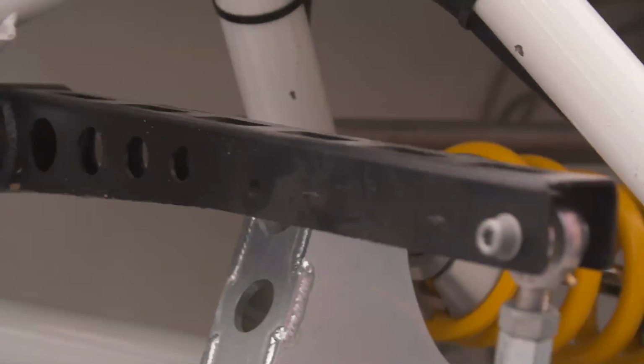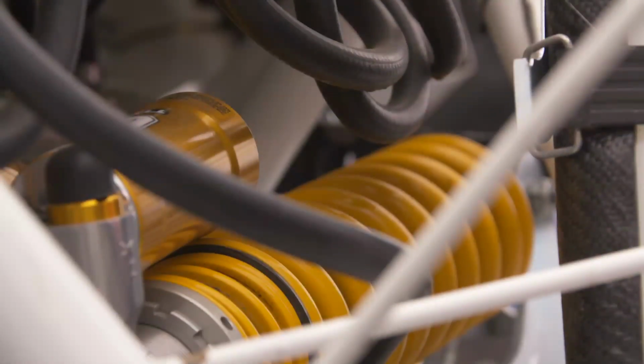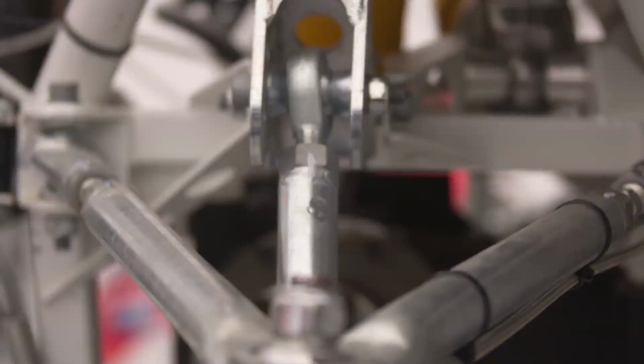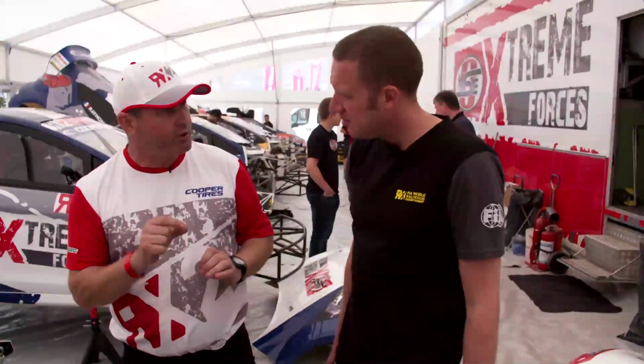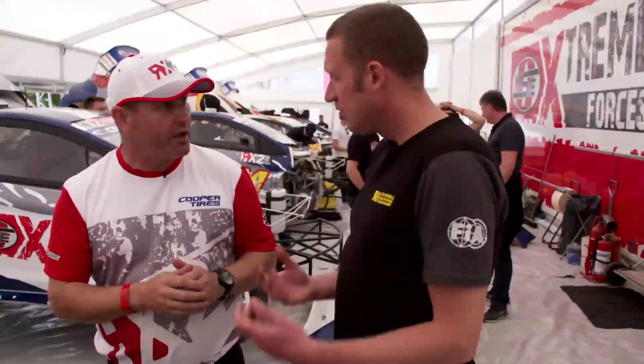You can change actual shock absorber settings within it, the bump and rebound for the hardness and softness of the car. And you can change the roll centers, which is what we see here on the bottom, camber, caster, toe. So again, it's a learning formula for everybody, from young mechanics to young drivers. It's enough to keep the cars equal, but if the cars get a really good setup on a good weekend, it just gives them that 2/10 a lap and sets them apart from the others.